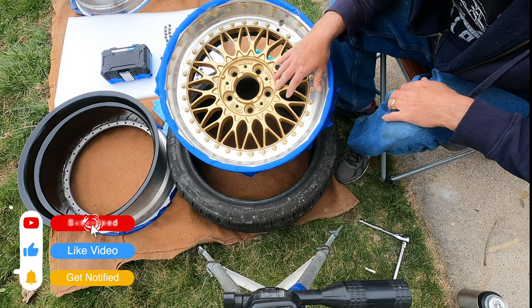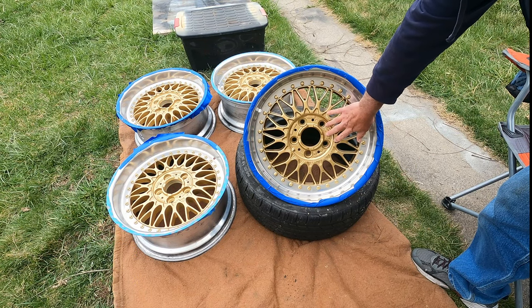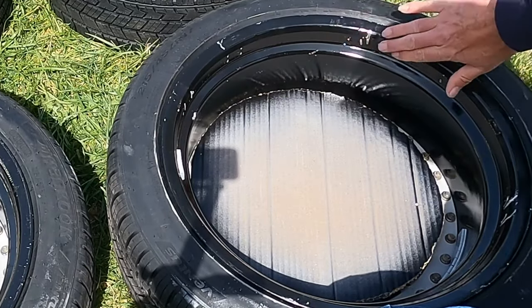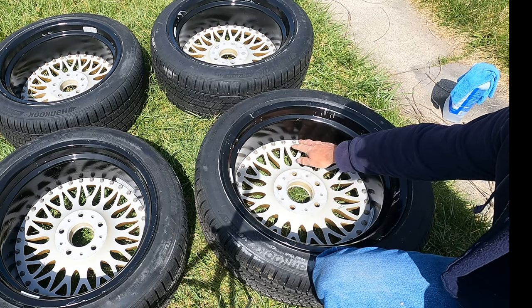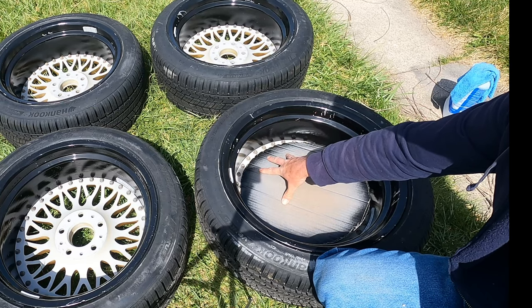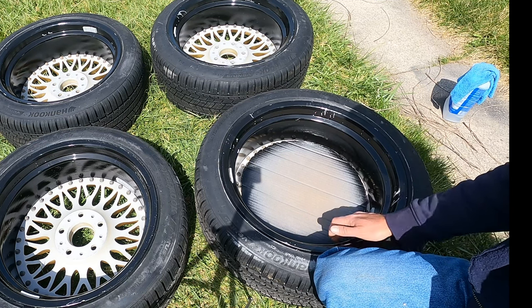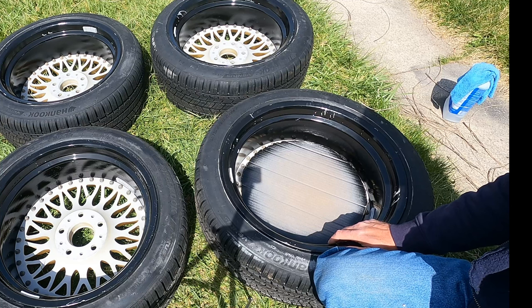We'll get those painted up and put on — they're going to look absolutely amazing. They look pretty good, they're not perfect, but they're all set to go and get mounted at the wheel shop tomorrow. I'm excited to get them on the car. So the tires are on, and you can see there's always some damage at the tire shop putting these things on. So I'm going to go touch these up. And because these nuts will rust, I'm going to go ahead and primer these nuts and paint them, so that we don't have to worry if we go to take these off that they're going to be all rusted and corroded. After that, all we have to do is flip them over and finish polishing the fronts, and they're ready to go on.